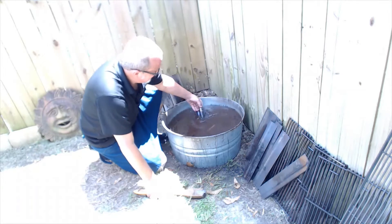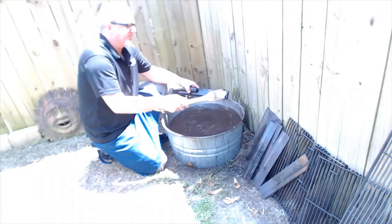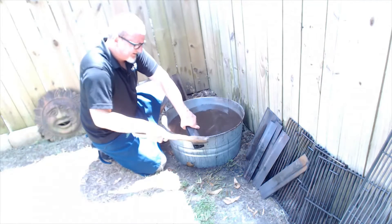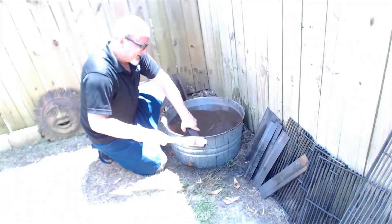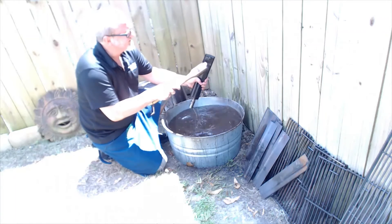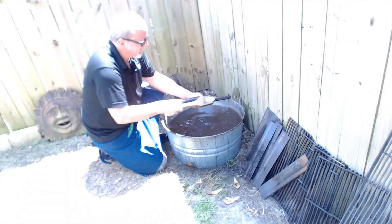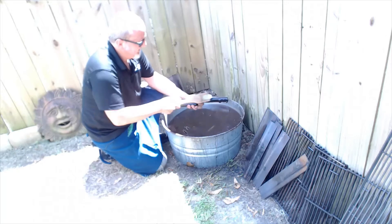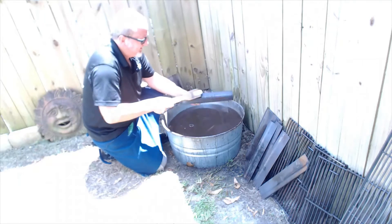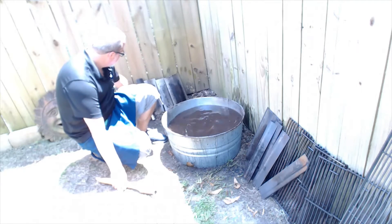Down to the burners. When you get to the burners, pay attention to the back end where it sits into the back of the grill — it gets a little gummed up there, so give that area a good scrubbing. Then this crossover channel — this little slot on the bottom side of the burner I was talking about earlier — make sure that's good and clear. Make sure you hit the ports one good time. Then the top of the burner, which will collect a little bit of debris. Then let them drain — set them up to dry.